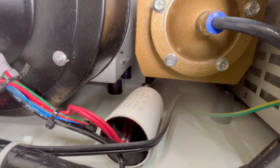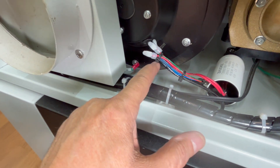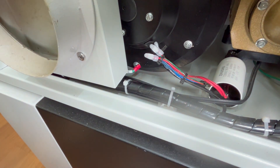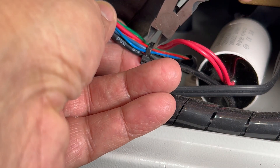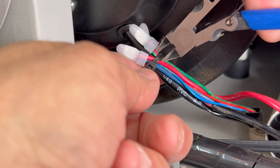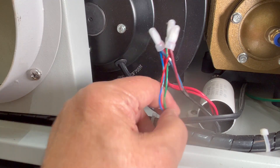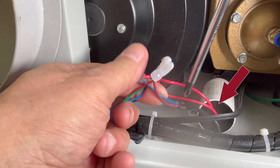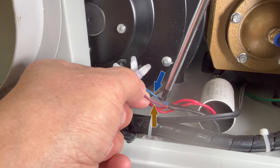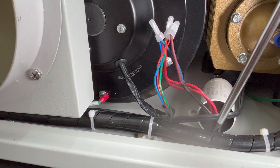The next thing I had to do is identify the wires coming from the exhaust fan and trace them to the power source. I noticed a bundle of wires close to the exhaust fan — they are tie-wrapped together, so I grabbed some small sharp dykes and cut the tie wraps off to separate the wires for a better look. I can now see where the wires leave the exhaust fan — there's black heat shrink sheathing housing three insulated wires. I continue to trace those wires and notice they are also connected to a capacitor.